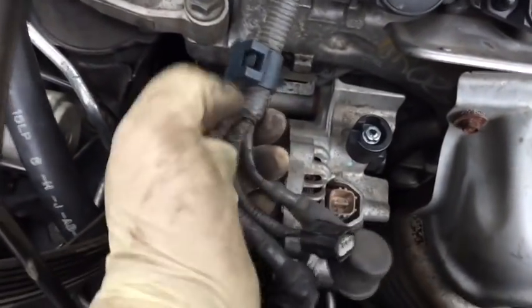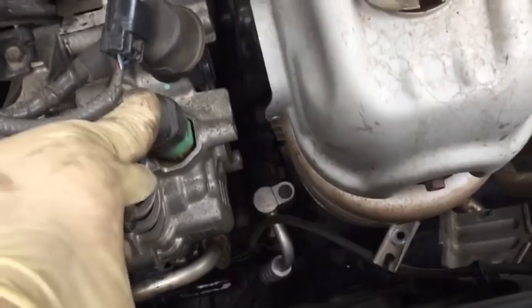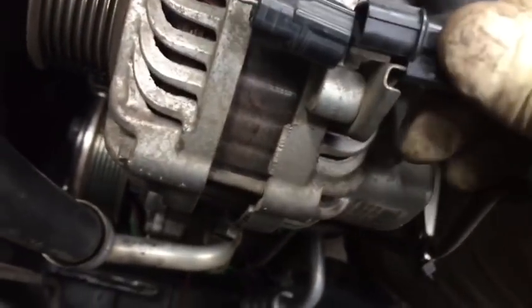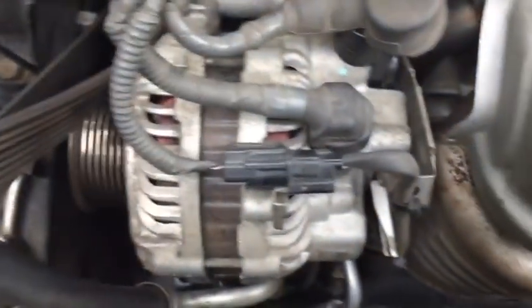This top wire I can simply slide back over this bracket and lock it into place. Hear that nice clip. I'm going to put my power wire back on. My control wires, they're just going to plug back in, and we'll shove our nice boot back over it. They're in place. This is going to go to the air conditioning wiring, which, remember, we took off the brackets there, but this wire is going to slide onto that bracket and lock into place as we shove it forward. And we can connect this wire here, lock it in, heard it clip.